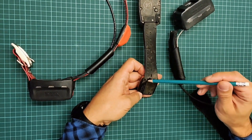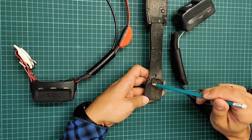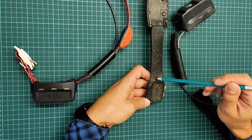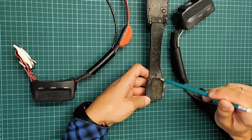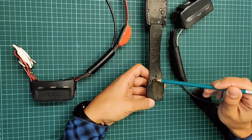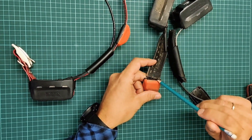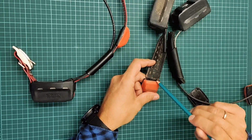But as you can see, over time this effect occurs — in this place where the plastic connects with the rubber, the harness cracks over time. It is easier for it to detach here because there is still a boundary of plastic, and in this place it acts like scissors. That is, the plastic, rubber, and cable often tear in this spot.